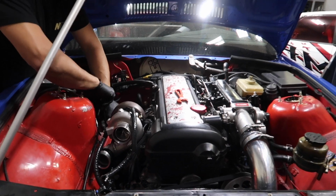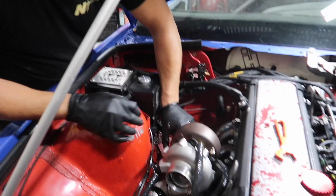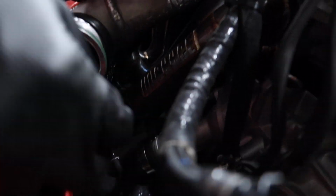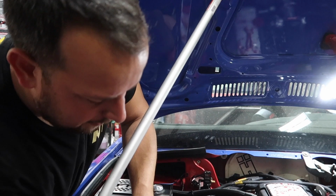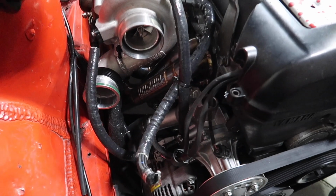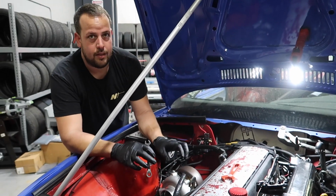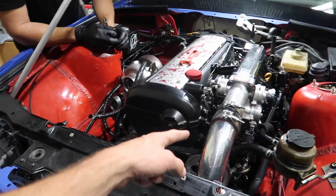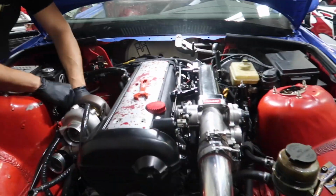But in the meantime, we got lightning speed with the new 1.5J. Alberto, tell me the biggest differences you've noticed so far other than the manifold clearance. Well, the motor mount definitely clears really good now. I ended up having to make a new oil drain line because it was too short. It was touching against the manifold, so I made a really long one now. I actually routed it in front of the radiator hose, so it's as far away from the manifold as possible. Then after I clock the turbo, we're gonna have to extend the downpipe. What about intercooler piping? I know this side was good. Do you think that side's gonna line up? I don't know, we'll see once I put this on. Well, that's a good thing.